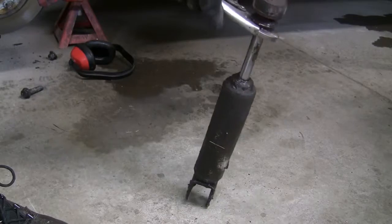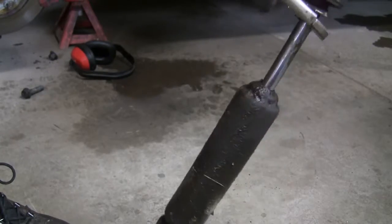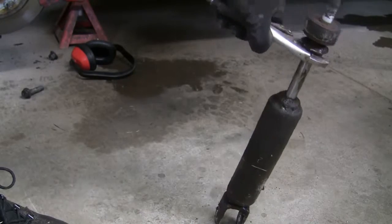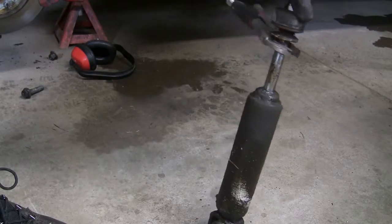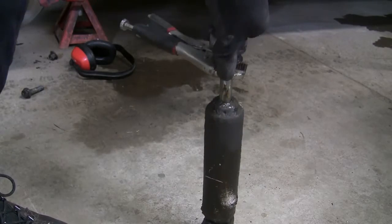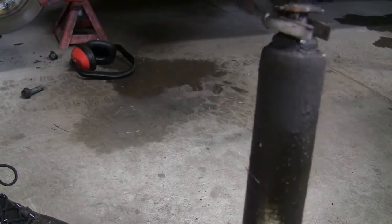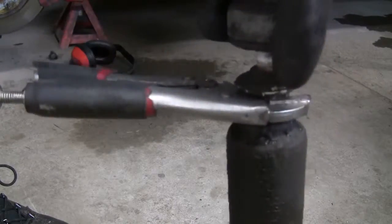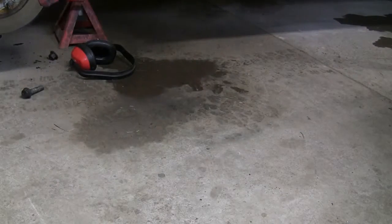It's worth noting, I ordered these shocks. These are not stock ones like I've been saying. They're ones for a 2.5-inch lift. But I was going to show you how easy these guys go down. They're not even that old. They're Pro Comps. But you can push it down easily with one hand. Easily. And they don't come back up on their own or anything. Not the best shock. You know, they weren't that cheap. $50. But let's show you the new fellows.